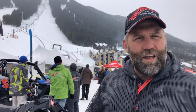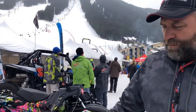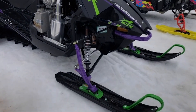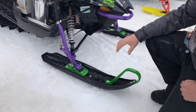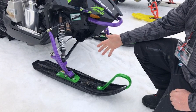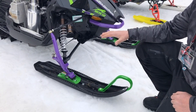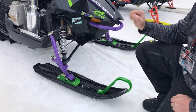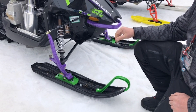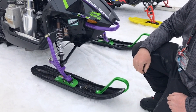It pops right up on the snow because of the way this thing is set up. I can talk a little bit about the skis — the Mohawk ski on the cats, in my opinion, the cat needs it probably more than any other sled. The reason being is the flotation this ski gives. It rides higher in the snow, and you have less chance of pushing snow in front of you. It just carves and bites and makes it a sweet part to ride.